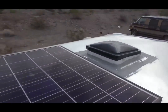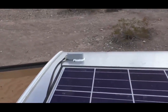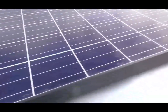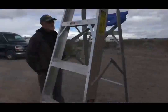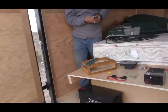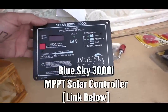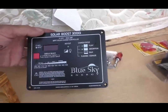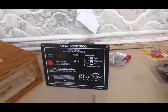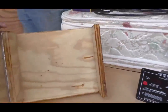We now have the solar panel mounted on the roof and our wires going into the inside of the trailer, so with everything on the outside completed, let's start work on the inside. The major components of a solar install are the panel and the solar controller — in this case it's a Blue Sky 3000i MPPT. It's a great controller — it can handle up to 400 watts, so Bob can build onto his system. It can even be calibrated to the specific battery, which we will do. We built a box to mount it onto the wall.